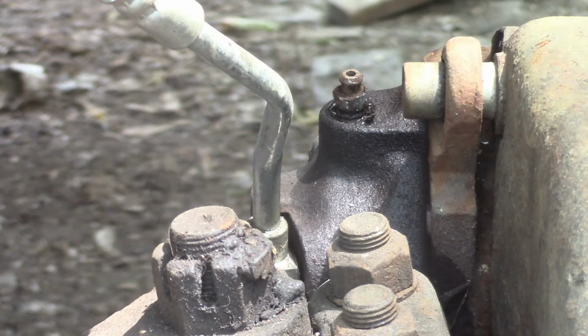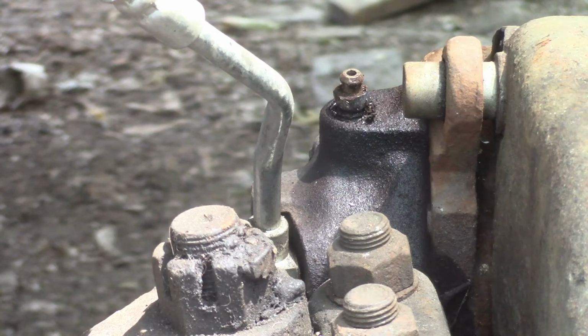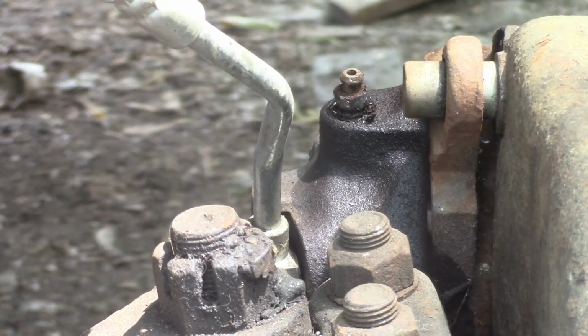and see if we can get some pressure that way. So next, I know the wheel cylinder on the back on this side, I got free once already, so we'll have to do the wheel cylinder on the passenger side, but I'm thinking it's going to have to be changed because the bleeder on it looks pretty rough, so I'll probably just have to buy a new wheel cylinder for it and get some stuff together here and we'll take a look at it.